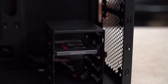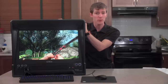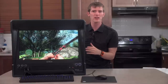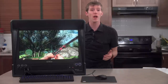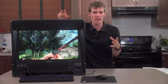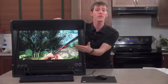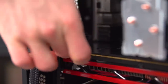The drive cages are functional, but I wouldn't trust them in shipping or with someone who isn't careful with their PC — they are not reinforced in any way, which isn't a problem for SSDs but can be a major concern for hard drives. The PCI slots really took me back to the good old days of PC building, but unfortunately not in a good way. I had to pry them out, something I've cut my hands doing, and the tool-less design just isn't very good. Tool-less PCI remains a holy grail of case design because most don't work, and the Drone Station is no exception. Worse, the tool-less hold-downs cannot be unscrewed or removed — you'd have to drill out the rivets — so I had to force a screw in from a weird angle.